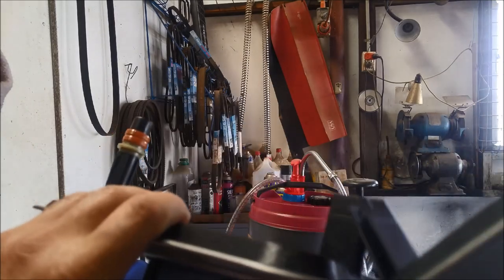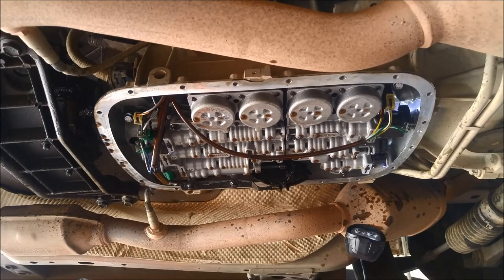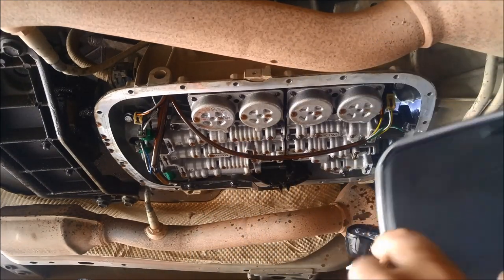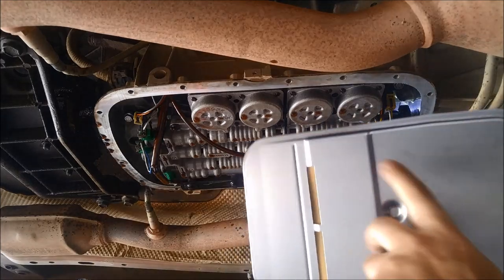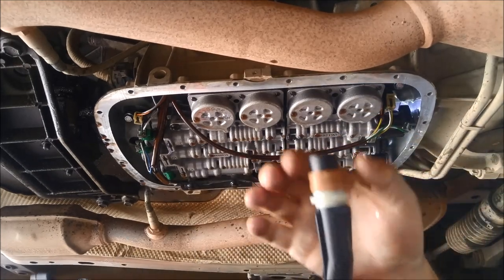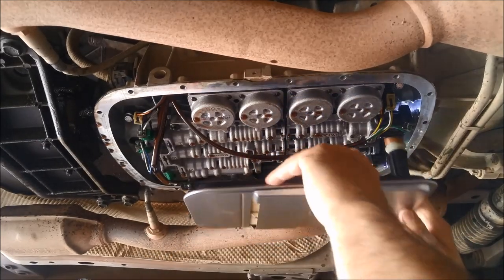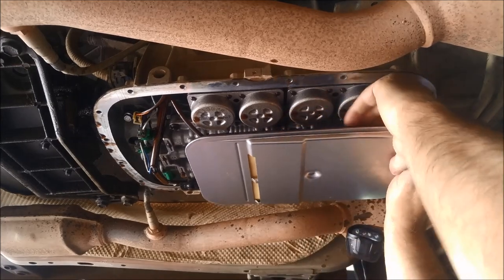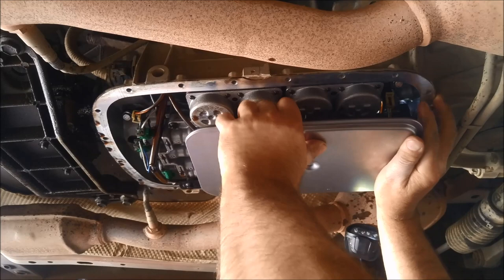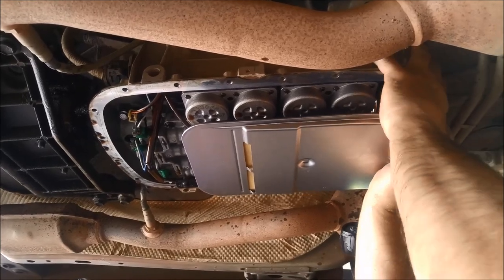The top part has these little spacers — everything's the same, the length, where the seals are, all the same. Just double-check that nothing's in there. When putting the filter on, make sure you've got the right one — the Holden one. It's just a matter of pushing it in. We've removed the two old seals, and if you try to take those off you'll see they're really snug and tight. Just slowly work it in there, pushing it up. And it just sits like that.